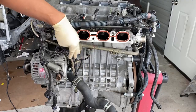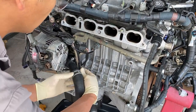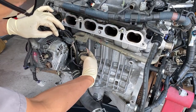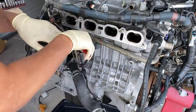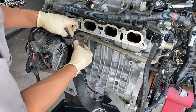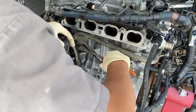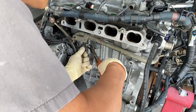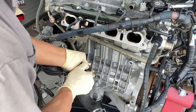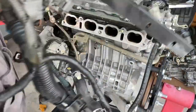Here you can see the rest of the harness that we need to take off. Let's grab the easy one right here — this is an oil pressure sensor I believe. And then let's take it off from right here. I'm going to release this one right here with my needle nose pliers. This used to be a connector, but I'm sure it just disintegrated over time, so I just tie-wrapped it there. Use the needle nose and we can pull this guy out. There's that one 90 degree right back in here and there it pops out. If we disconnect this guy — this is to the crank sensor — now we can take off our harness. And there is the whole harness removed.